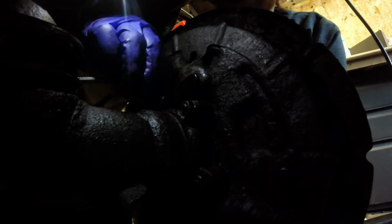So now we just got to reflare the old brake line and then hook it all up. This might be easier than I thought. Watch, now it'll take me 3 hours. I did it. Got the new brake line on there. No leaks. Let me get a light real quick. There you go. No leaks from this. It is all good to go.